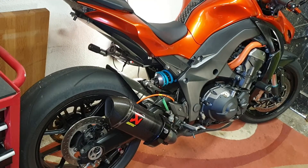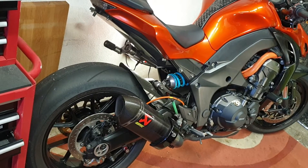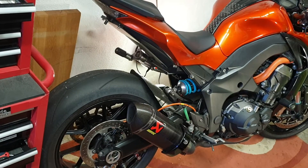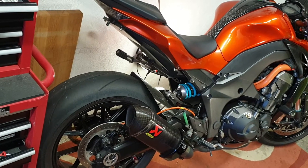So if you were to do that airbox mod — the one that's in my other videos — of essentially lopping the bottom of it off, putting some gold tape on it to insulate it from the heat from the top of the engine, and also opening up the air intakes. That's really down to if you want to start cutting your OEM stuff apart.